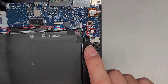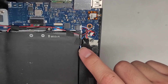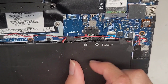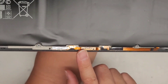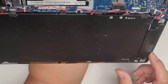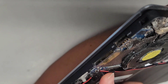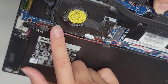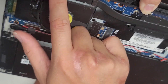There's the CMOS BIOS RTC real-time clock battery — connects right there. You got the speaker connection here — the blue and white wires go there, and the black and red wires go to the other speaker. The battery connector is here; it just pulls straight back, so you have to remove all the screws for the battery first. There's also a battery indicator light cable, and a cable connecting to the SD card slot, USB ports, and whatever else is on that side.